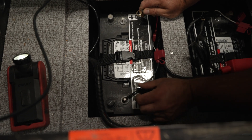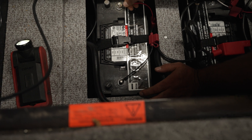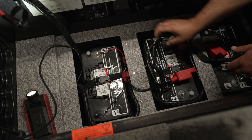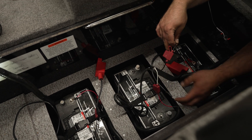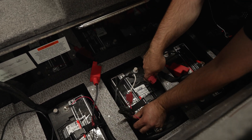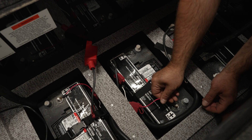The first set of wires we always want to put on our batteries is going to be our charger wires. We'll go ahead and reinstall all our charger wires. Make sure you're putting them on the right post — negative, negative, positive.